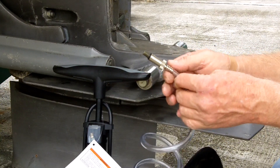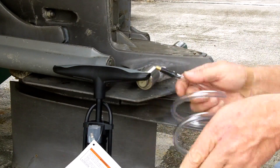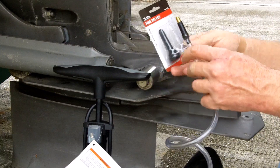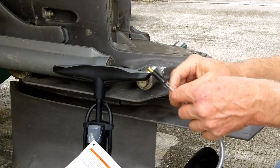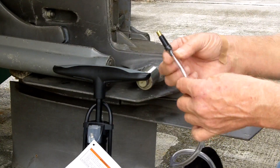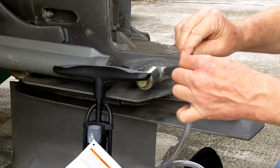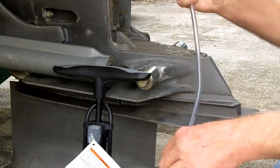There's no need to use a clamp or anything on here, and this has no ring on it so when you screw it in, it does seal. This is a typical Schrader valve for a tire. I just took a razor blade and cut around it, nicking away at it until I got it down to a smaller size. Then I took a heat gun and heated this quarter-inch inside-diameter plastic tube from Home Depot and was able to push the Schrader valve in. It's such a close, tight fit there's no need for a clamp. That's what I used for the pressure tester.